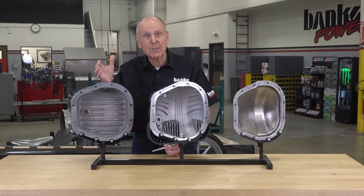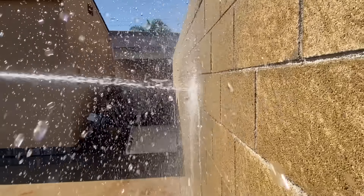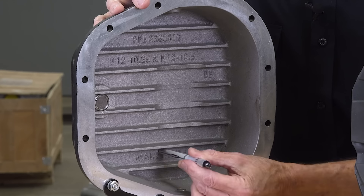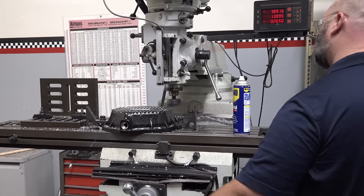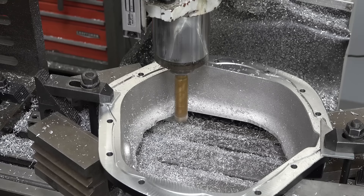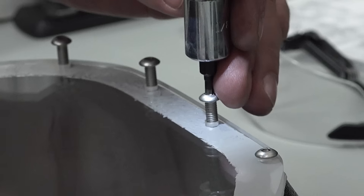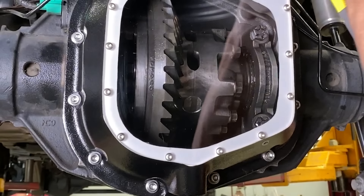Ever aim a fire hose at a brick wall? That's what's happening inside these flat back covers, and it's all bad. Does anything get to the ring and pinion interface? Does anything get to that front pinion bearing at all? Well, I'm not Superman — I can't see through these things. What I did was get Mike in the machine shop to put the Mag Hitek on the Bridgeport and mill off that flat back right down to where the radius in the casting begins. It duplicates exactly the insides of the Mag Hitek.